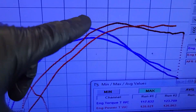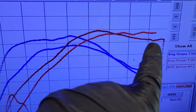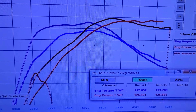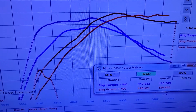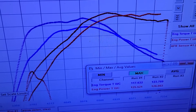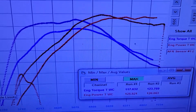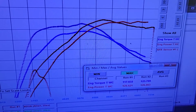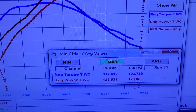The one here has a little higher peak torque value but falls off up top in horsepower. If you look at the scale on the bottom, the other graph makes more from 5,900 RPM up, and the one graph makes more from 5,900 under. The change was the cam timing — he had the intake cam moved seven degrees ahead. So I tuned it seven degrees ahead and then moved it to straight up, to give him an idea depending on what track he's at and where he wants the power. I'm gonna guess he'll want to put it back, because it's much easier to pass people with horsepower out of the corner. Down the straightaway helps, but if you can't get next to the guy it doesn't really matter.